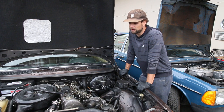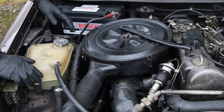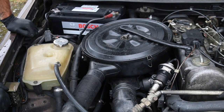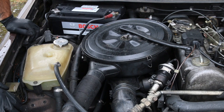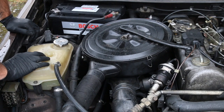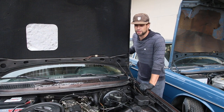So we're going to take a closer look at the EGR valve and some of the soot and carbon buildup it's been encountering. Now some of you might be thinking that based on the color of the smoke, maybe Digby's problems relate to a blown head gasket or maybe a cracked cylinder head. Over the last couple of weeks we have been driving Digby quite a lot and we have seen no signs of overheating and no signs of coolant loss. It's starting to rain, so we're going to get Digby in the shop and take a look at that EGR valve.